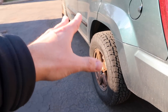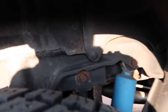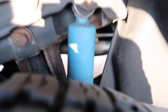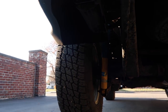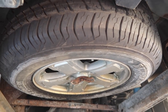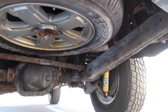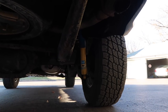To fit those wheels, I also did a Day Star two-inch spacer lift — you won't really be able to see it — and I installed Bilstein 4600 shocks because the suspension was just shot. You can see the yellow shocks at the rear. There's also a stock spare tire back there, which I'd never actually use, but there it is. That's the lift.